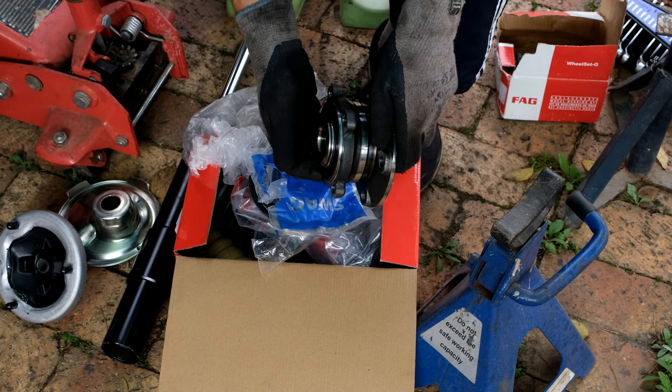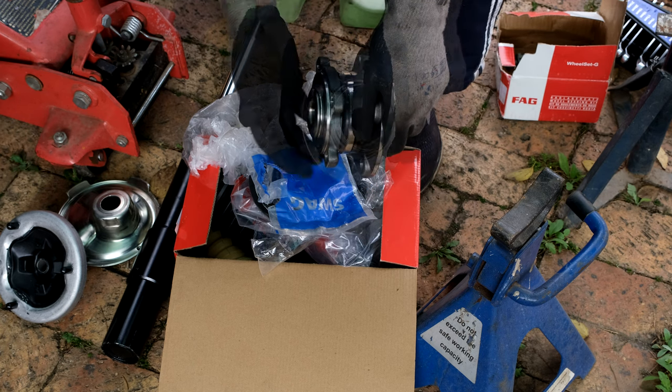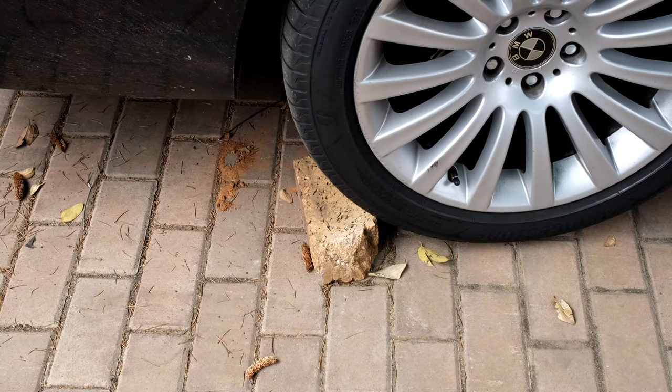Often when you remove the coil you find this rubber is deformed — it's not a very expensive part so I've got a replacement. Often people don't replace this one. There's also a bearing that goes on the top of the shock. When doing the shock absorber repair you might also want to consider changing your front wheel bearing if it's a little bit worn, especially if it's making a noise. I have a video showing how to replace the front wheel bearing.